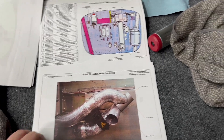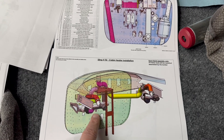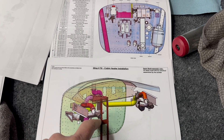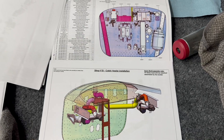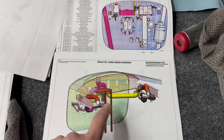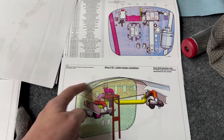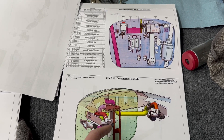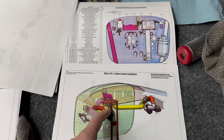This 'octopus' manifold thing is new. There used to be a heater that took coolant from the engine, put it into a coil with a blower — that all got removed. When we talked to Sling about this, they said removing that heater core was actually an improvement, because once you get it in here and rivet the top on, it's very hard to get behind there and access the heater core. So having nothing electronic back here that can fail is technically a win.